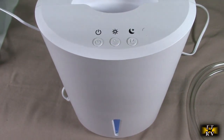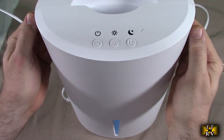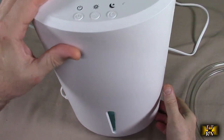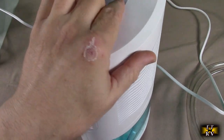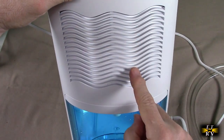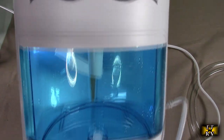What's cool about this is it uses dual semiconductor coolers — that's why there's heat coming out of both sides. There's no compressor in here, it's all electronic. There are little semiconductor coolers inside that condense the air. There are two cooling plates — you can see the aluminum plates in there — and then it drips down.